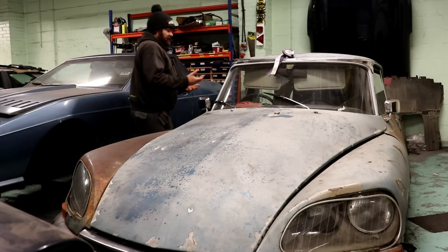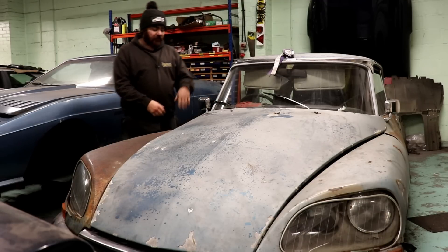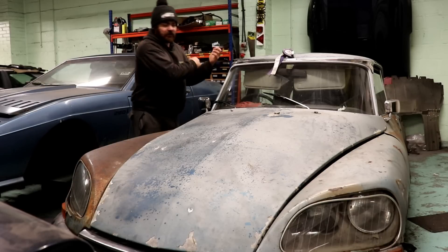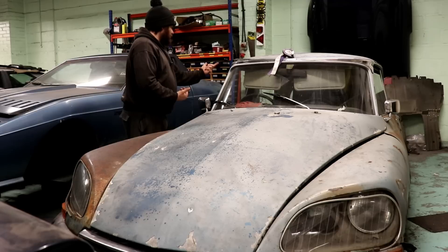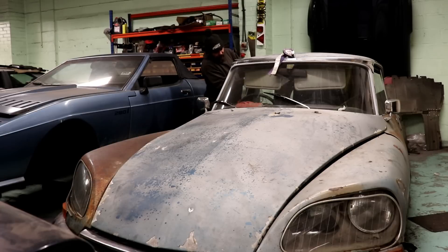For now I need to get the roof off - that's the first thing. Then I'm going to try and take the windscreen out, all this trim, this brightwork's got to come off - doors, wings, bonnet. But I'm not going to take any of the front off until I've done this, because when I'm grinding and welding there's going to be lots of sparks, and this protects the engine. I have absolutely no idea what I'm doing - I can see some screws, I'm just going to undo them and pull stuff off until the roof comes off.